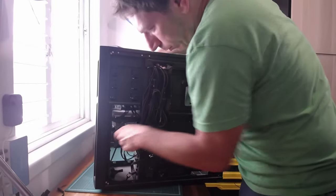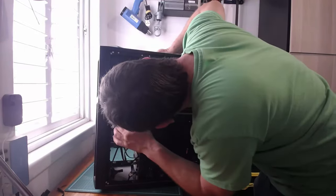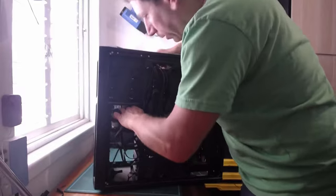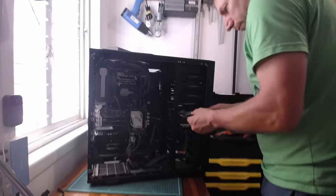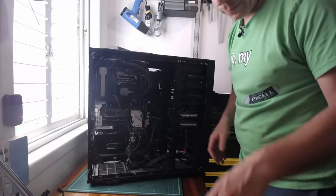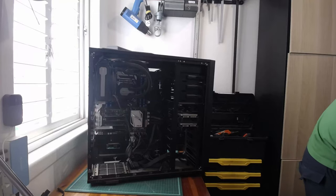Because these hard drives here, these two big ones, are connected in RAID, which means they're mirrored. So whatever is on here is automatically written down here as well. And the reason is, this holds my photos. And my photos are my most valued possessions. All right, but it's all backed up somewhere else, so me disconnecting the RAID means that they are no longer mirrored, and when I connect them later on, they will be wiped and I'll have to bring back all the data from later on.